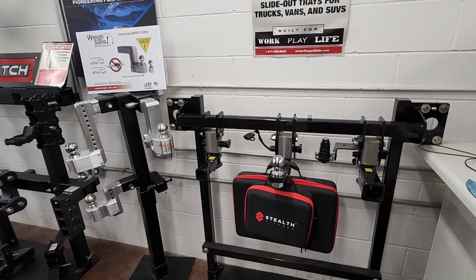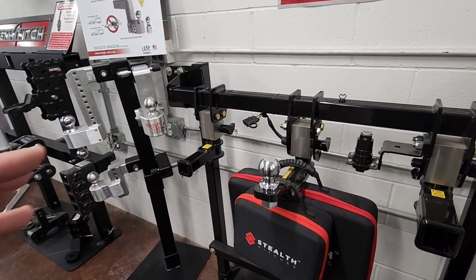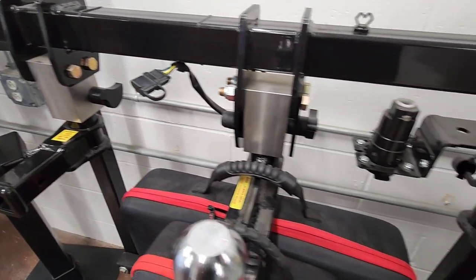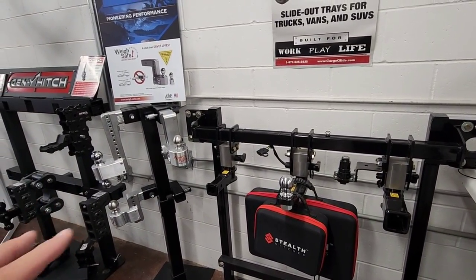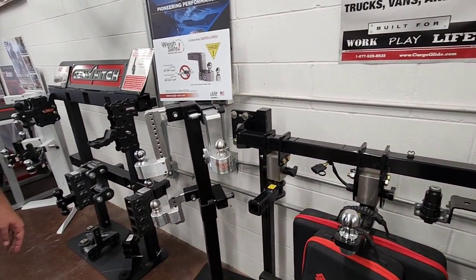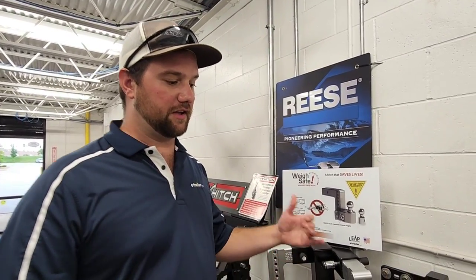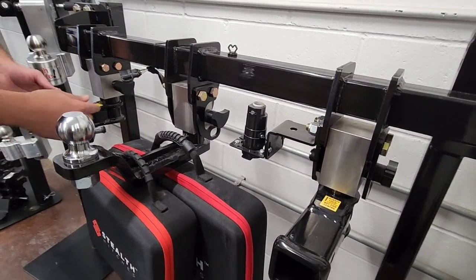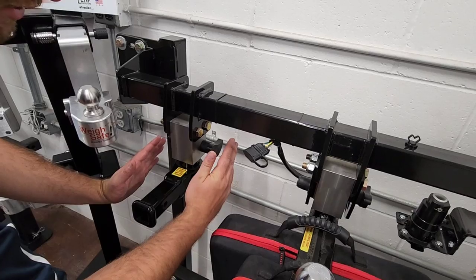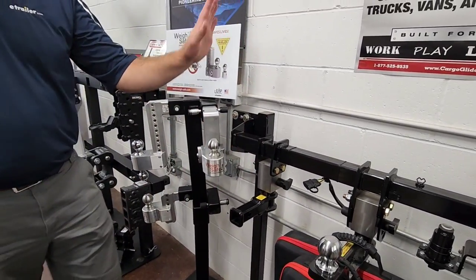We're going to start over here with arguably the strangest looking hitch I've ever seen, and this is made by a company called Stealth Hitches. It's super confusing looking — if I saw this I'd be like, what am I looking at? The ones here are locked in place for demonstration purposes. The reason you would want a stealth hitch on a vehicle is so that your hitch is in stealth mode when you're not using it. It comes in three variations: an inch and a quarter, a ball mount, and a two inch hitch receiver. You twist this knob up underneath your bumper fascia, the hitch receiver slides out, and when retracted your bumper fascia covers everything so it looks like you don't have a hitch at all.